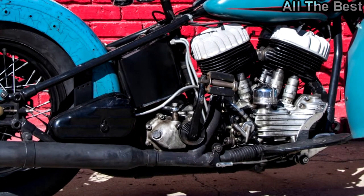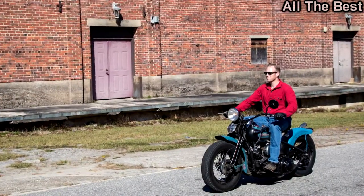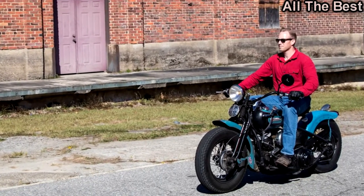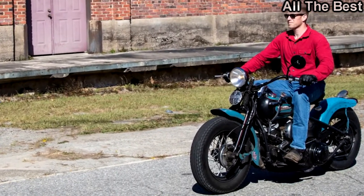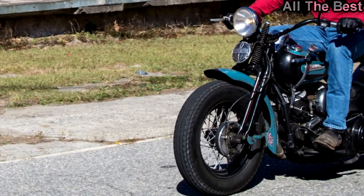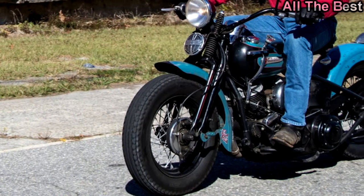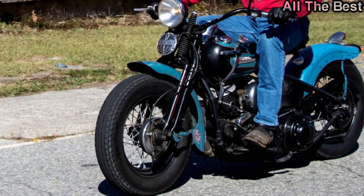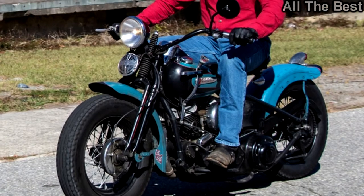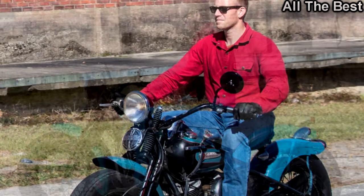Harley-Davidson debuted the U-Series in 1937 as a replacement for the V-Series, which had been their primary line of big twins since 1930. One of the most notable improvements found on the U-Series was a new design which recirculated the oil from the oil tank, through the engine and back to the oil tank. Up until 1936, all Harley-Davidson motorcycles used total loss systems which essentially ran the oil from the oil tank, through the engine and ultimately onto the ground.